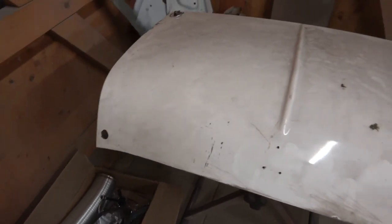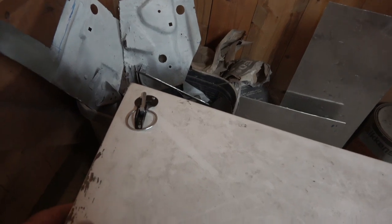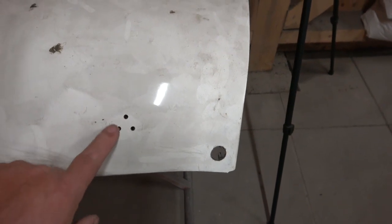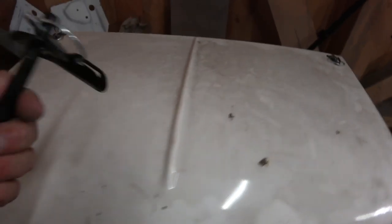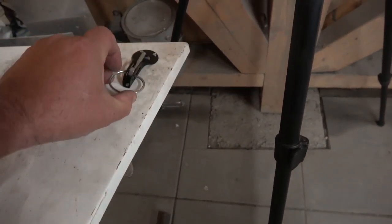What I've done to get them symmetrical - because everything looks to the eye - I measured here, here, and here. I had to open the holes very slightly and you can see they're the same now. I'll put these two on which will go this way because I need the flatness. This has obviously had buckles or a bonnet strap on it but we can deal with that. We certainly don't need the badge on it. I'm going to fit these up now - I'll mark inside exactly where they need to go on these clips, nice and tight, with 3mm bolts.